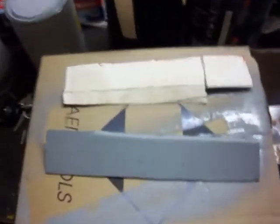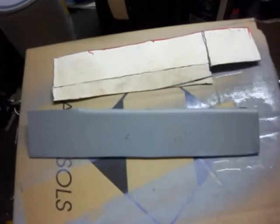I don't know if you can see this or not, but that's obviously the other side. So when the patch is in, which is in here, got a state of my garage. Pre-drilled 8mm, 5/16 holes. Normal way I do everything, all of my patches. Make a template. Try the template. Alter the template. Do everything you can on a bit of cardboard before to make the fit right, before putting it on to the steel and then maybe getting it wrong, maybe. That's my story anyway.